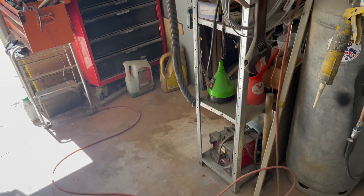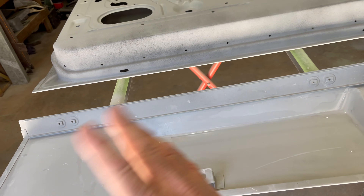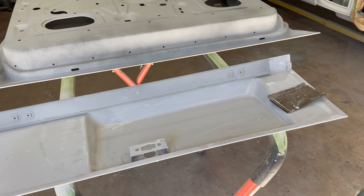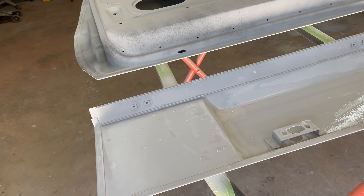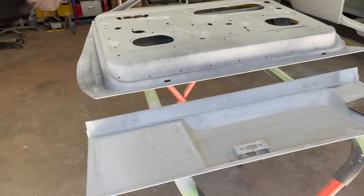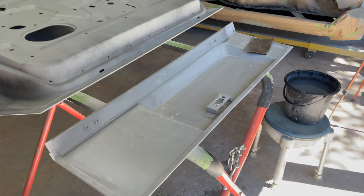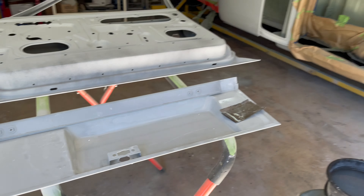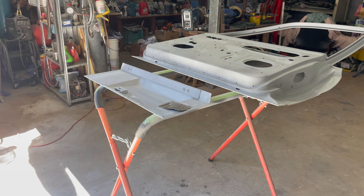I need as clean an environment as possible. I think I might give the roof a bit of a blow over to make sure nothing can fall out. In case you're wondering why I'm fiddling with 800 wet-and-dry on these insides where it doesn't really matter — it turned out pretty good because I've never sprayed base with clear on top before. I want to practice on all these inside bits first because if something goes wrong in there it's not the end of the world, but if it goes wrong somewhere more important I'd be a bit upset.